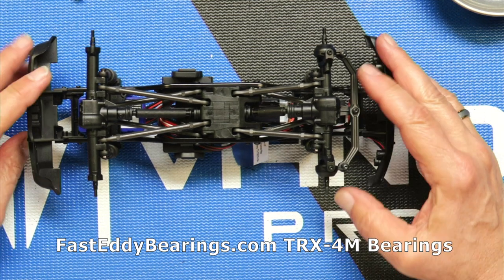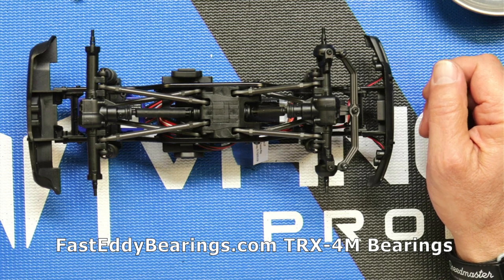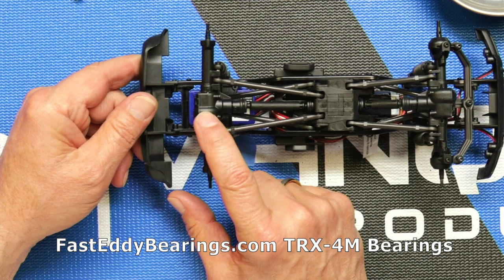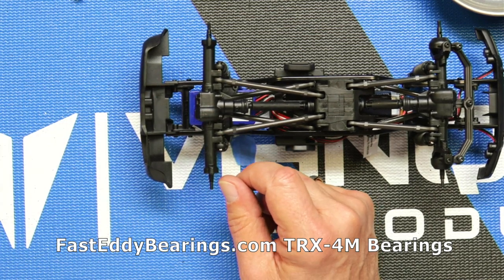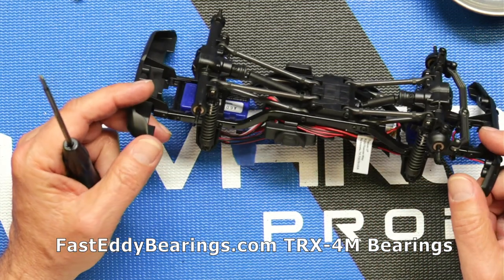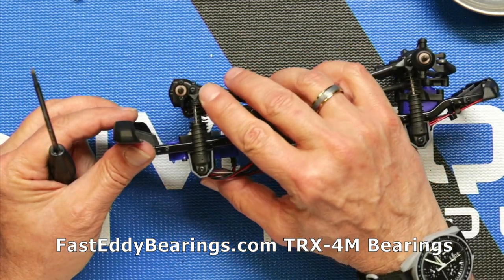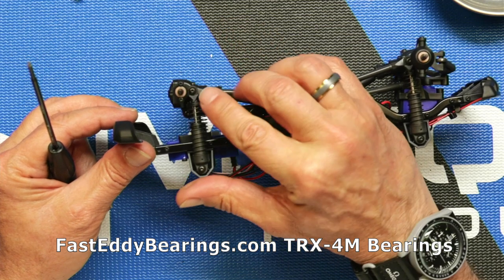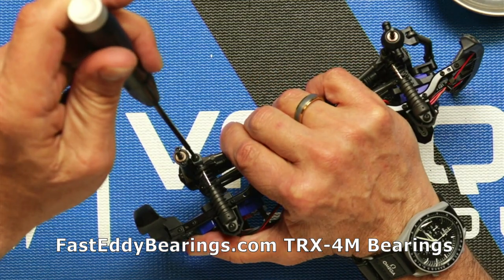All right, now we have all four tires removed and we are going to start with the rear axle. To start off, let's go ahead and remove the screws from the bottom of the shock absorbers — there's one on either side. Your kit did come with the proper size Allen wrenches, though we're using a different set. I'm not going to suggest using a drill with bits on this — they are probably a bit too strong for this project.